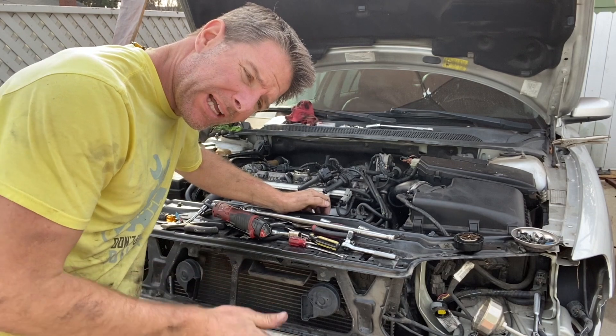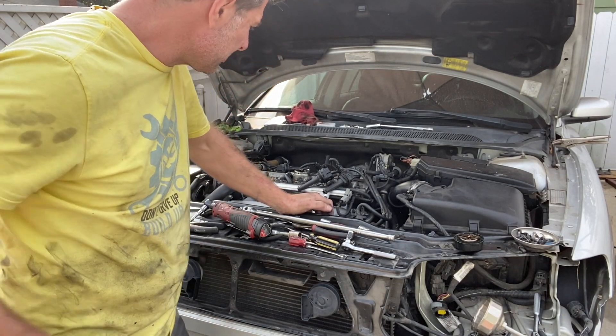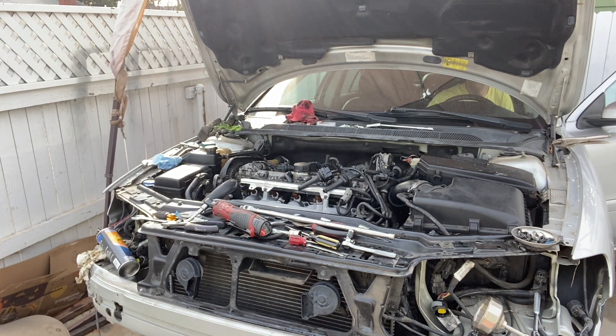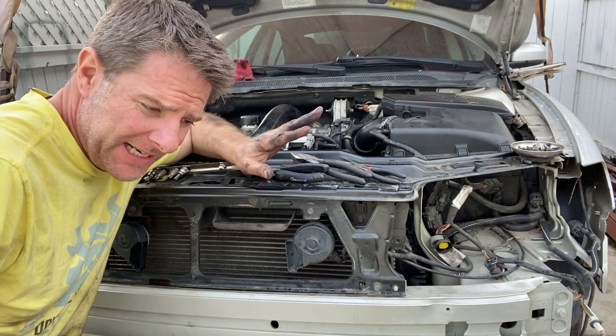While using my logic and blowing the oil out of the cylinders, I actually want to see if the oil light goes out as well, because I want to build up full oil pressure before the car tries to start. Right now the coils are out — she ain't starting. We have oil pressure! Plugs are now in, everything's connected, so it should start.